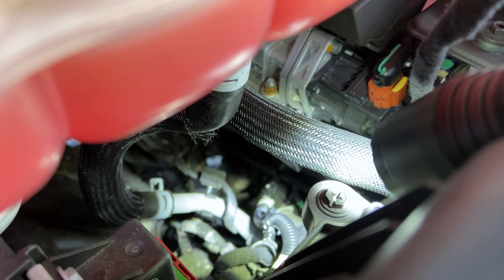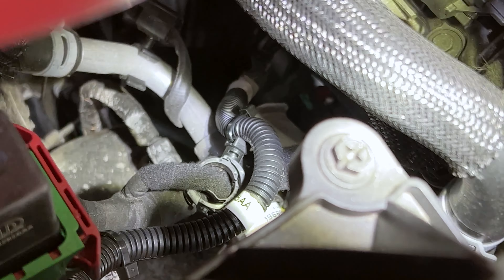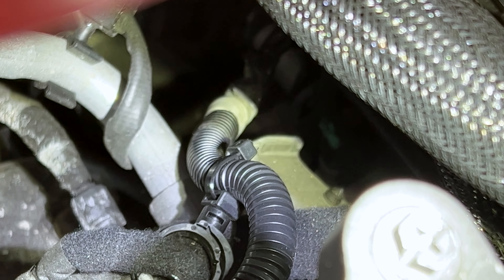The electrical wire is not touching that coolant line — not a refrigerant line, a coolant line — which will get pretty warm, so don't let it touch. I might move that back a little bit so it's off of it, but it's on top of the heat shield so it's probably fine. It runs all the way down and connects at the bottom. You clip it in on the far right so it comes straight up and connects right there. I'll probably move that zip tie so it's not resting on the coolant line metal piping.